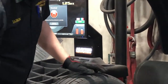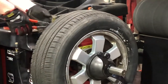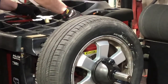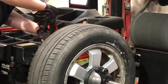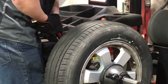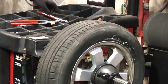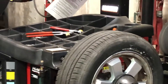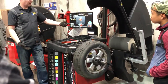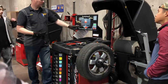So I'm going to go ahead and do that. Jason asks: what is excessive road force? Well, that's what it's showing right here. If I had 19, it's okay — it passes. I'd like to see 15, that's pretty good. But it's saying the number is too high — there's too much — and it would like to correct that. So it wants me to measure the rim right now.